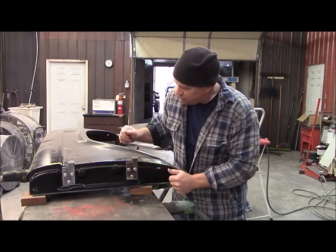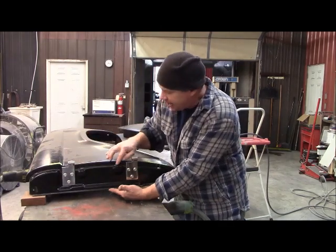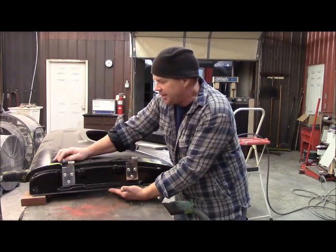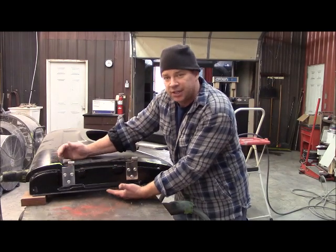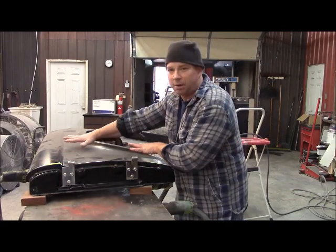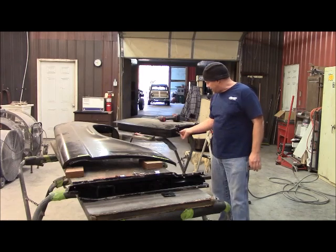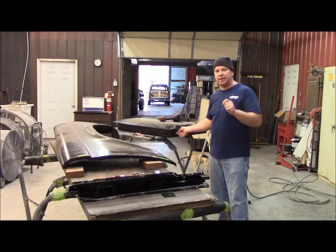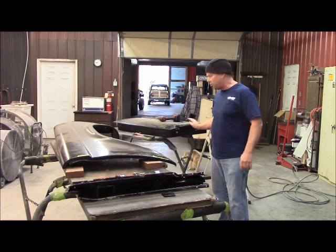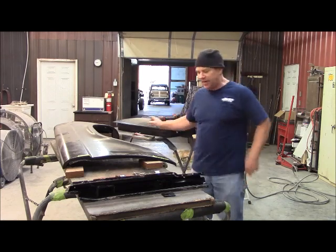I've got to move this post down into the door a little bit. I've got it bolted in place with all its adjustment maxed out, but I need just a little bit more — looks like about three millimeters down and it's got to come out a little bit. If I get that in place, it looks like I won't even have to do any body work on the outside. I've opened up these holes just a little bit to a three-eighths hole and got all those bolts dead center of that hole, so there's quite a bit of adjustment right there.